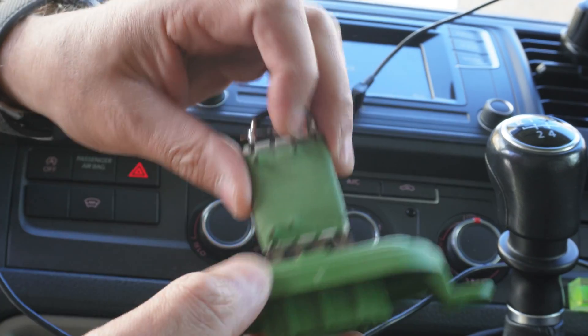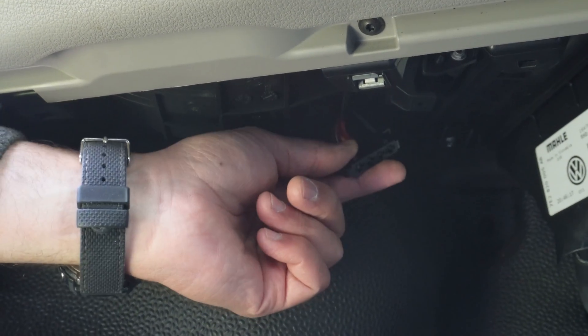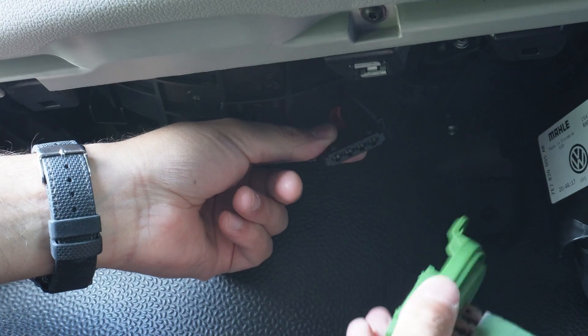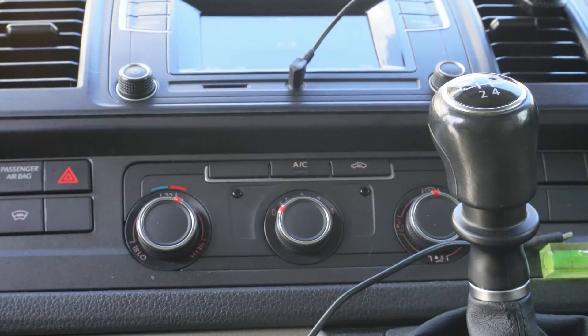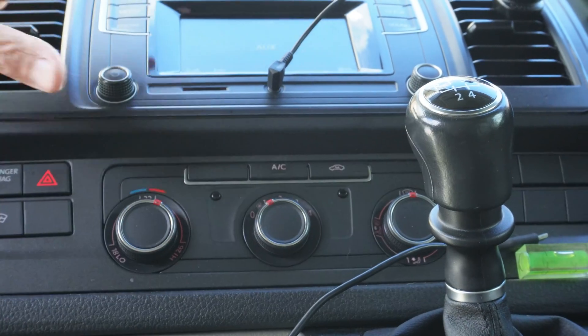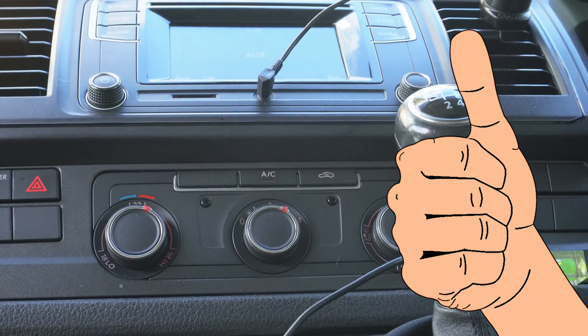So it's really simple. This is located — if we come down here, underneath the dashboard — we've taken out the plate. There's the electrical attachment and this is located in here. If I plug this in now — this is the old one which I've shorted, so I've bypassed the thermal fuse on it — you can hear that's blowing on one, two it's blowing more, three it's blowing more.